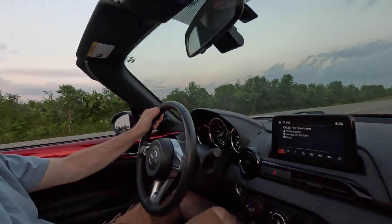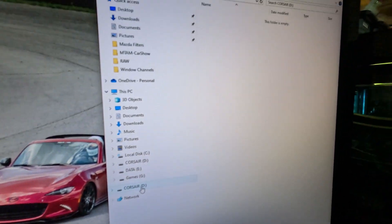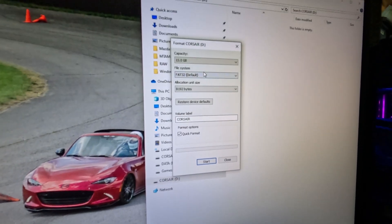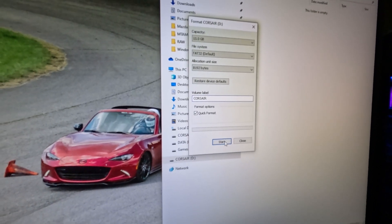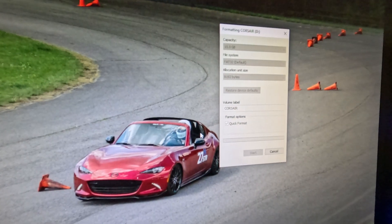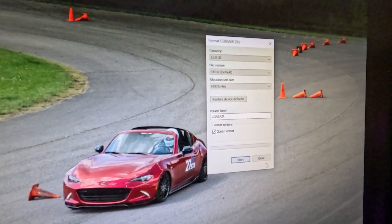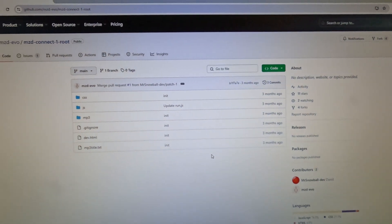And yes, we are moving. With thumb drive in — mine's called Corsair — there are no files in it, but it's going to delete any files. You want to go up to Format. Make sure FAT32. You can label it whatever you want, then hit Start. It'll delete everything. Format complete. Close. So now the drive is ready. If it was already formatted for FAT32, you probably didn't have to do that.